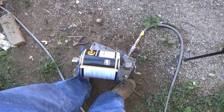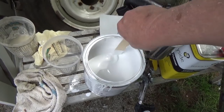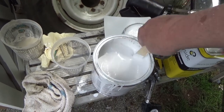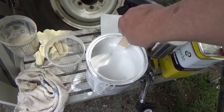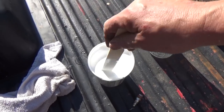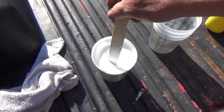I've got my pneumatic paint shaker in use. I like using polyester primer because it goes on very super thick and it's very high-build. It hardens up well. There's no thinning required — you just mix it up, put the hardener in it, and shoot it. And it really does build up fast and thick, so I'm going to go ahead and shoot this all over it.